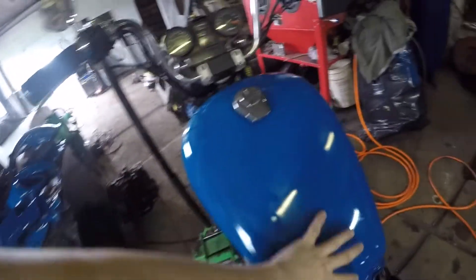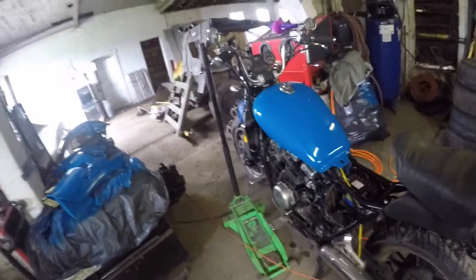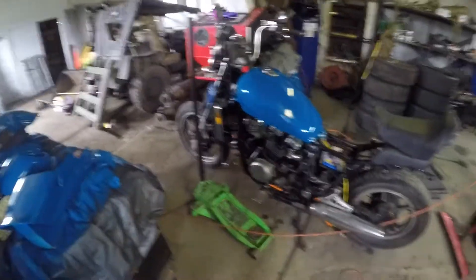There was some old clear coat I had from painting my very first Jetta, which I didn't even make YouTube videos for when I did that. It worked really good with that, but it did not work really good with the bike. Either there was something on the tank or something wrong with the clear coat — it's about five years old — and it just left a whole bunch of marks and pits. It just looks so bad, so this was the best option. We just repainted it in about an hour, but it's been drying for the last couple of days.